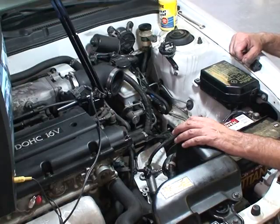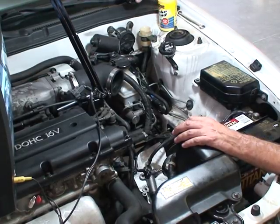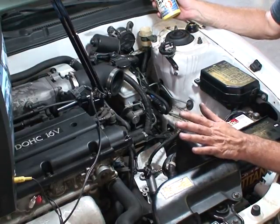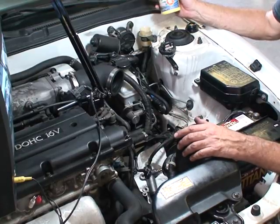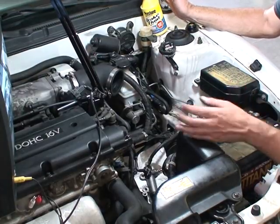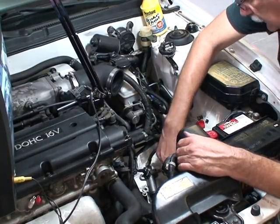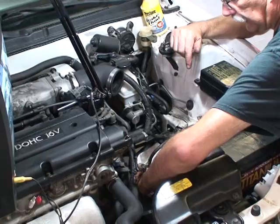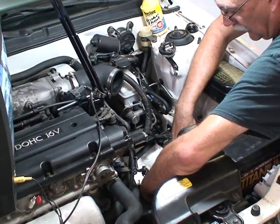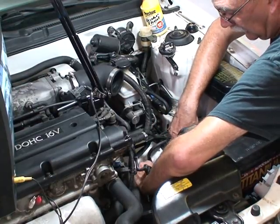Just to act as a little bit of lubricant. Now for the fun part — bleeding it. I'm personally not a big fan of putting brake fluid in and pumping on the pedal and opening the bleed screw. Yes, that has its place, but in a clutch we've got a couple of different situations. In this particular situation, I'm going to allow it to gravity bleed. I've got a tube on the slave cylinder going down to the basin, and the bleed screw will be just about at the highest point of the system.